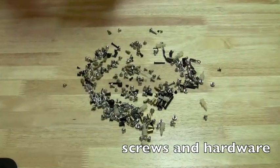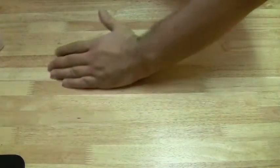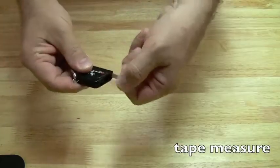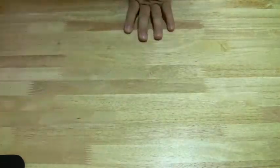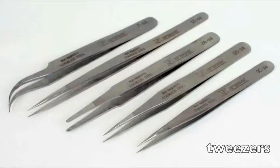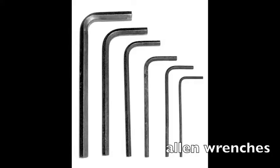Every time I have leftover screws or I acquire small screws from anywhere, I collect them and put them in a small case — you never know when you're going to need them. It's nice to have a couple little cases around for screws, rubber pieces, and different things when you're taking apart laptops. Get yourself a tape measure or ruler so you can make measurements or size things up, which will definitely happen especially with laptop screens. Also get yourself a set of tweezers — you're working in very confined areas, and if you drop a screw or need to remove a wire, tweezers are the tool you want.